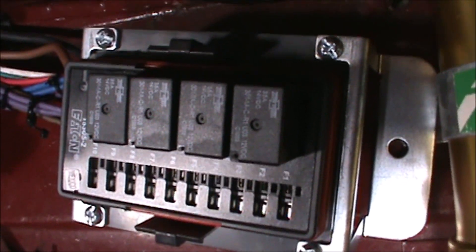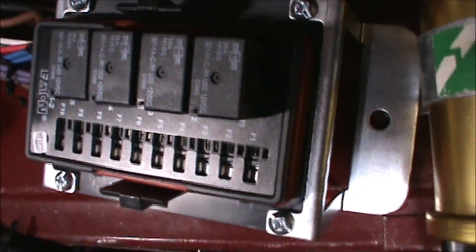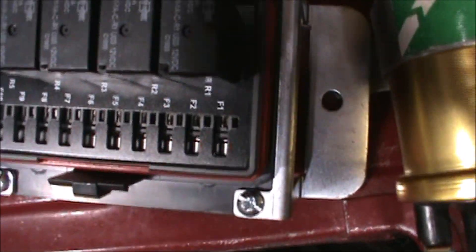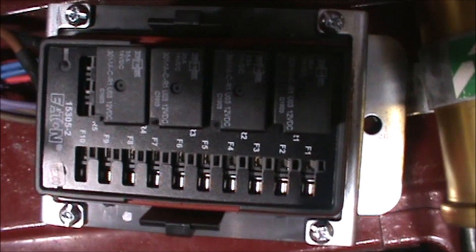I've included plugs into any cavities that were not used, and I'll post all of the components used to build this RTMR. The relays are already installed — these are single-pole single-throw relays, so they're four-pin relays. I haven't done the calculations yet for all of the fuses, but I do have a nice box of fuses ready to put in place. There's one relay that is not being used — something for the future — and those related holes are plugged with cavity plugs.